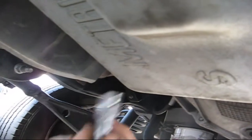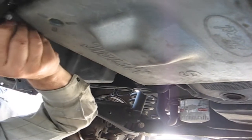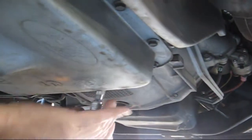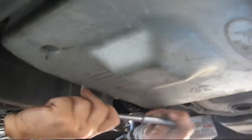These happen to be number 10 metric. I'm going to loosen everything up and sort of keep these bolts in. When most of these are off, I'll finish loosening and let the pan tip out and let most of the fluid drain off. Let's just start — I almost don't need a wrench for it.